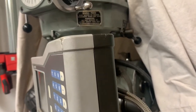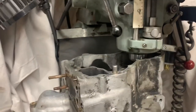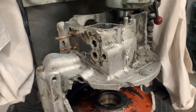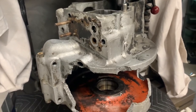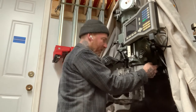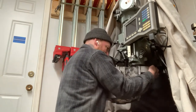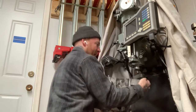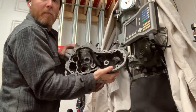I have the Bridgeport set up in low, which locks the quill out. And once we get her nice and tight, she'll be ready to twist out. So I got it set up in here and I'm just going to do a little rocking motion back and forth while pulling down on it a little bit - and bingo.